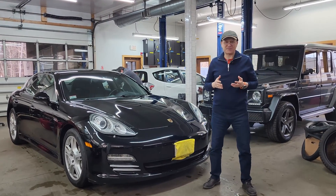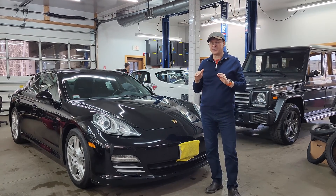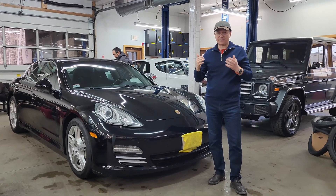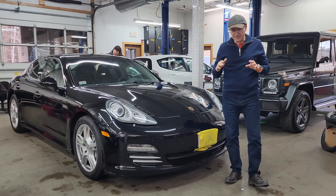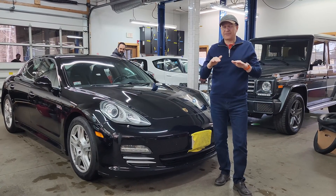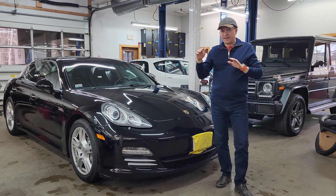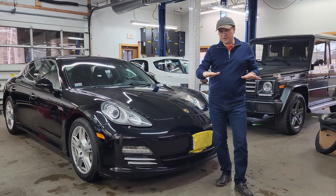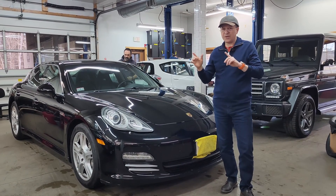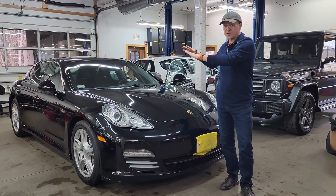Welcome to the last segment of our Porsche Panamera air suspension video — a very happy segment. It's been almost three days; we left the car outside untouched and the suspension height did not change at all. We have nitrogen inside and there were some temperature changes, but it didn't move a bit. To sum up: the car had an intermittent issue, but in the shop it was a consistent problem with the vehicle losing height — at some point all four wheels, then later the front wheels only. We used our custom isolation tool to determine that the front struts were causing the front end to drop.